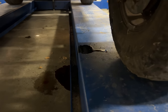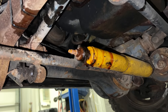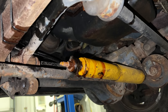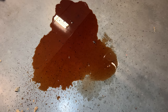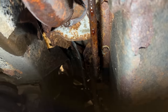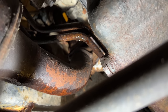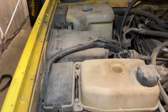There's a puddle underneath the truck. Looks like we might be leaking oil from somewhere — it is just absolutely dripping oil or fluid of some sort. Let's put it up on the lift real quick and check this out. Now that I can see it better, you can see the fluid is actually reddish in color. It looks like the transmission lines have become rusty and are leaking. So it's not engine oil — it's transmission oil. Everything's back in place, and I was using the original engine control computer when I started it.